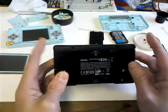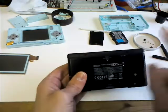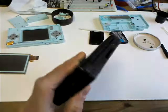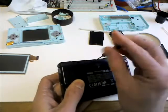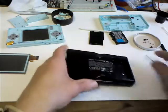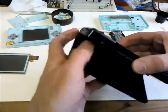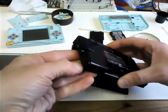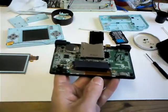The best way to do this - and you've got to be careful - these shoulder buttons have a little spring in them, and if you lose that, you're done. Also, there's another little screw, a tiny black tri-wing screw right in by the cartridge slot, so just undo that. Now what I usually do is take my fingers on the cartridge slot and lift that back pad up a bit and open it slightly. Don't go tugging it right out. Take your thumbnail around - you'll see a gap opening up where the front joins to the back. Run it right around to the front and it usually pops it open.